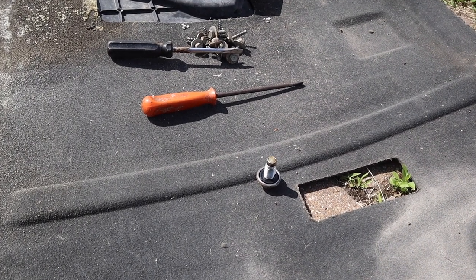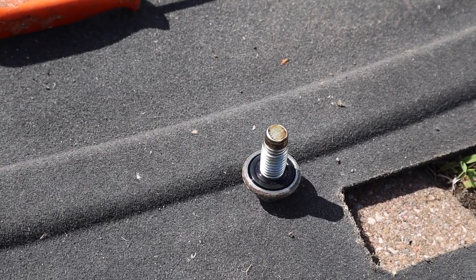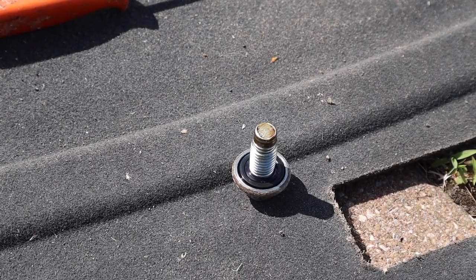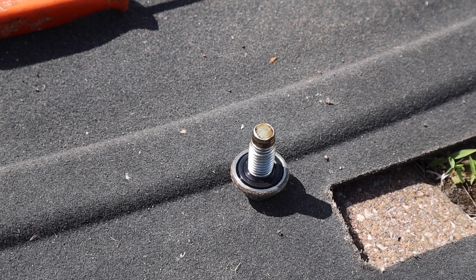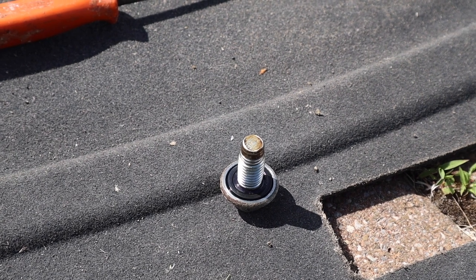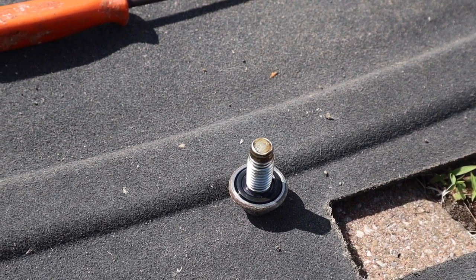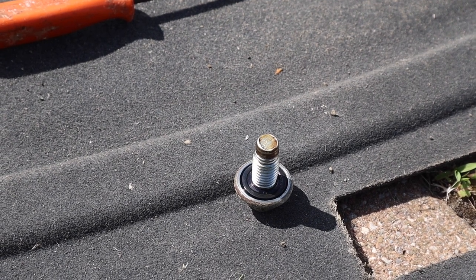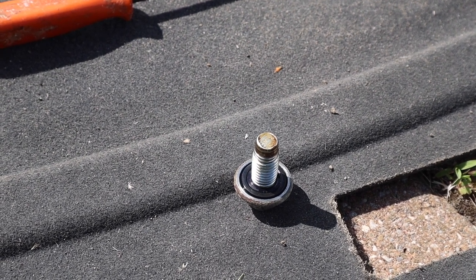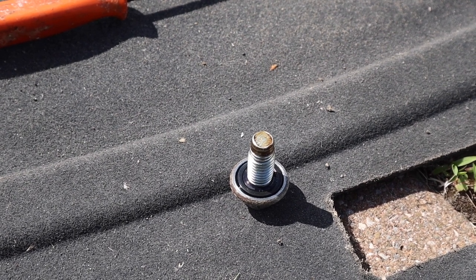I had to use a cheater bar to crack it loose. Now the interesting part is, I can't zoom in too much here, but it seems like they've put an internal drain plug washer on this drain plug, which is a very interesting design, and it seems like it's durable, and it also seems to be holding up, and it also is not prone to the quick lube plastic drain washers to dump the oil once they loosen and damage, trash your car's engine.